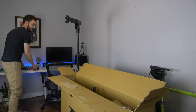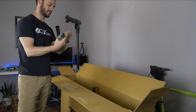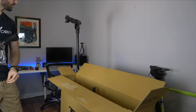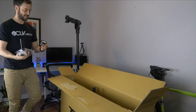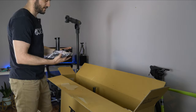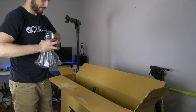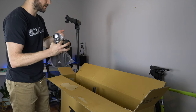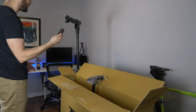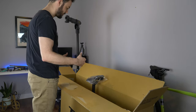For a carbon bike like a Trek, or if you have a carbon seat post or a carbon seat mast cap — such as this one — you'll want to add some carbon gripper. Carbon gripper is kind of like a grease, and you just take a little bit and put it inside the seat post to prevent it from slipping. Then you torque the seat post on with a torque wrench — these are set specifically to about 5 Newton meters and are really good for seat posts and handlebars.